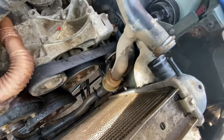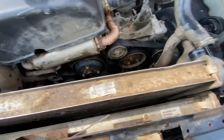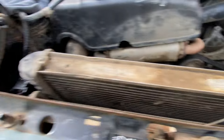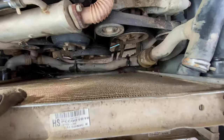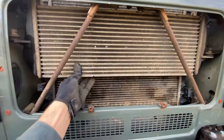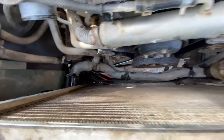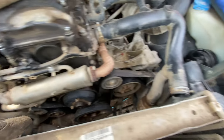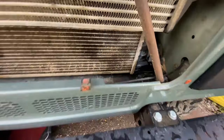So what I need to do is take this radiator out. I've disconnected the hose up here and the small hose just here, so those have been taken off. Now I'm slowly unscrewing the radiator on some of these fixtures and fittings. It's the first time I've ever done anything like this, so let's see how it goes. I've realised you cannot remove the radiator without removing the intercooler very easily, because as you can see they are clipped together here and here — which is not what I read online. So I'm going to have to remove both of them together. I also had to take the intercooler airflow hoses off to be able to get to it, so it's turning out to be a much bigger job than I thought.